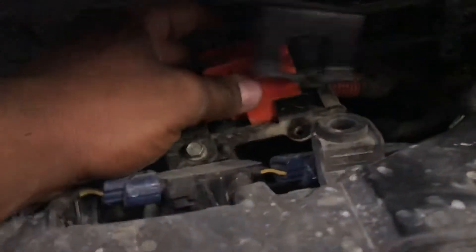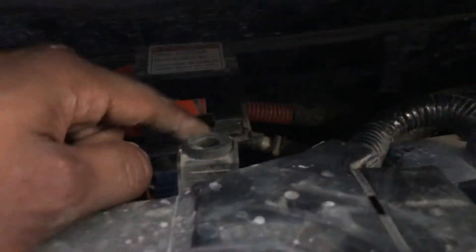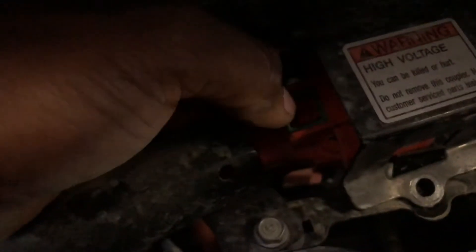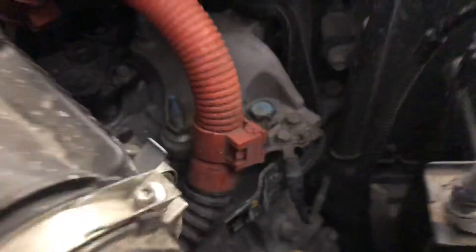Come over here — this is the connector. That orange wire down there is the hybrid cable for the AC. Disconnect the number 10 right here, lift up on this, and there's a green tab right here. Pull that tab out, then push in on the little orange piece and pull the cable. The cable has a few places where it's just clipped on — all you have to do is pull up on this little lever right here and pull out on it like that. Remove that.